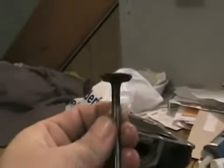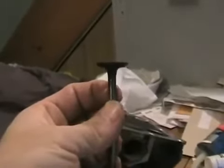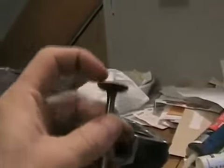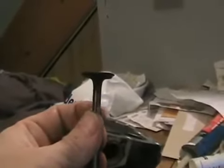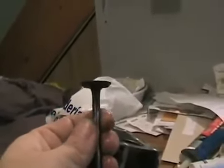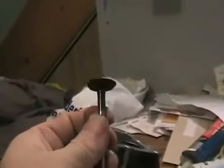So this part of the valve is actually very flexible, so they bend easily but they're easy to straighten. Many people watching this will say that'll never work, it'll only last a little bit, it will never seal right. Well, when the piston fires, there's a lot of pressure in there — the downforce on this valve could be a thousand or two thousand pounds of air pressure, and that actually makes the valve seal even better, just in case you haven't got it 100% perfect. Since I've done this job so many times on high-revving motorcycles, on cars, on any kind of overhead valve engine, and never has the valve ever broken or had a problem in the future, I know it works.